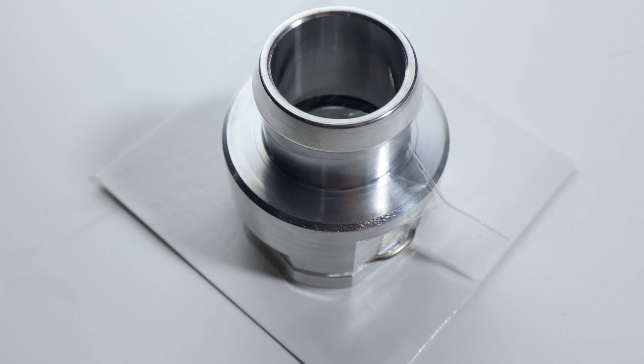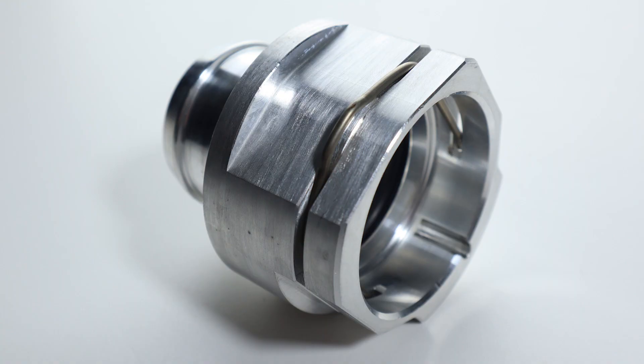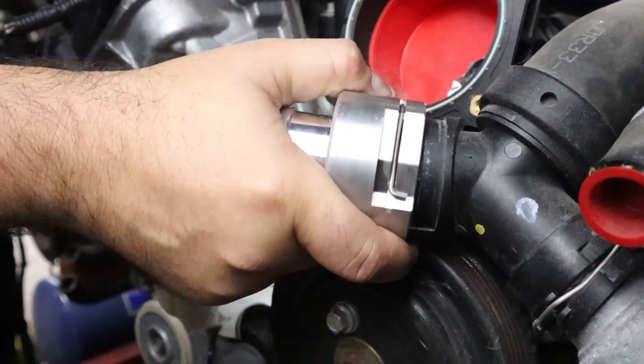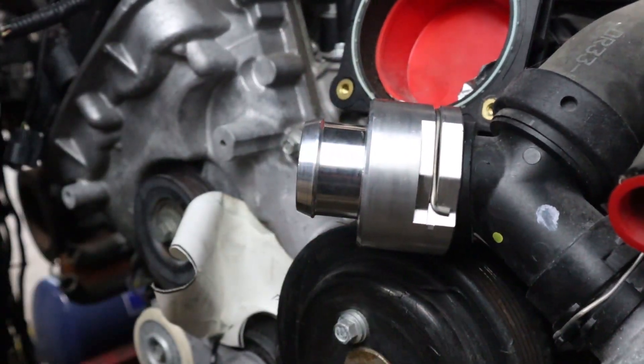For the installation of the upper radiator hose adapter, all we have to do is remove your factory upper radiator hose. Do not worry about any of the clips or O-rings — you won't be reusing those at all. Once you've gotten the upper radiator hose adapter out of the package, it already has the O-ring installed and the retaining clip on it. You're simply going to line it up with the upper radiator hose housing right above the thermostat, push it in until you hear the retaining clip lock into place. Once it's locked into place, you're ready to go ahead and put the hose on with a new hose clamp and finish the installation.